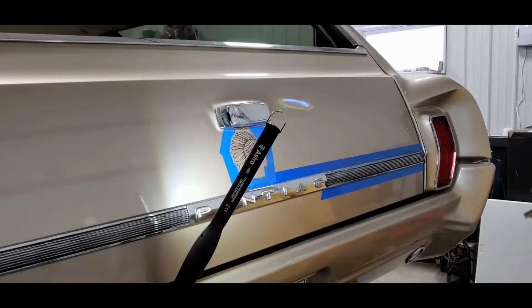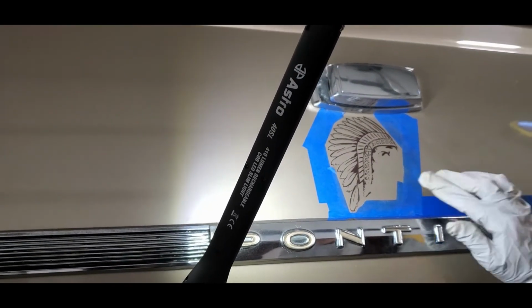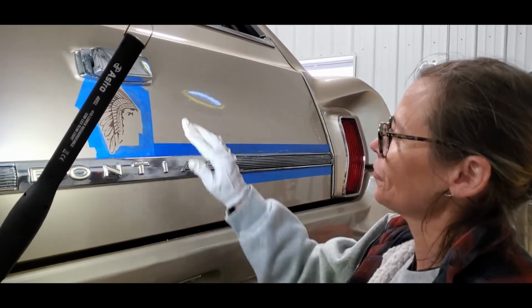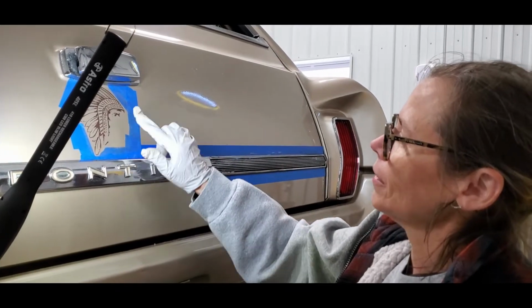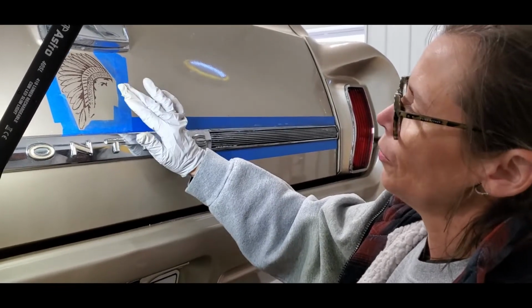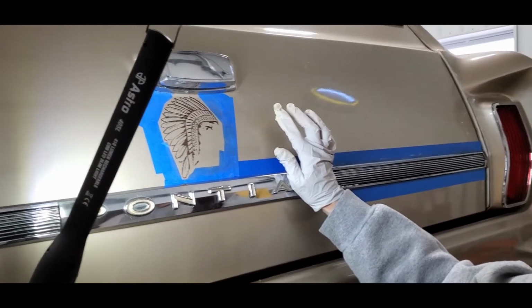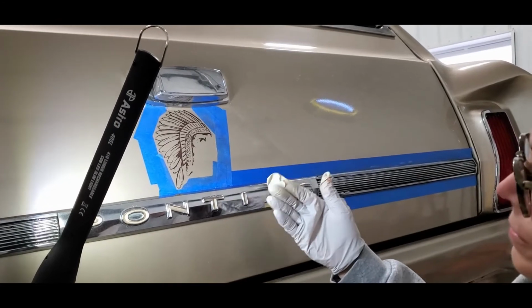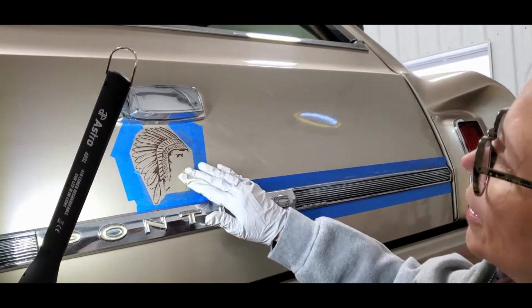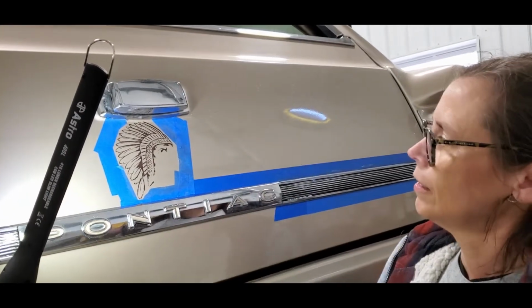ShopDog's snoozy. So after some internet searches, I am using a microfiber cloth with lacquer thinner on it. Test the spot before you do this to make certain there is a good clear coat on. The lacquer thinner will not affect the clear coat. So putting that on, you hold it down, try to keep as much just on the paint that you want to remove, and then rub it. This seems to be really thick, so after I rub through, I take rubbing compound, and I run through the rubbing compound, and that helps to buff everything off.